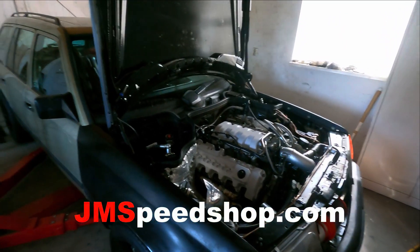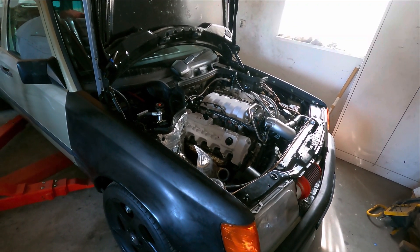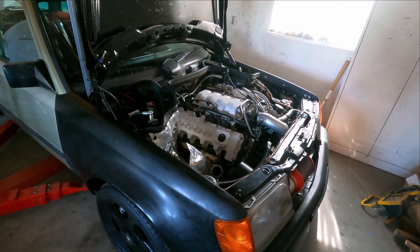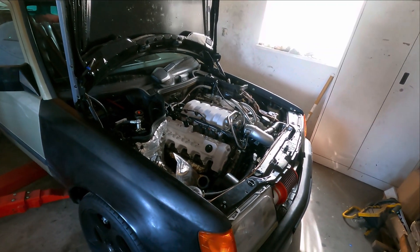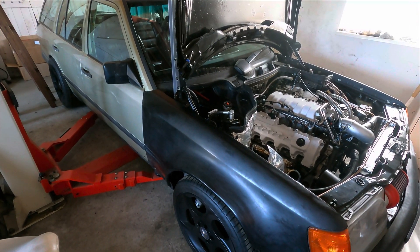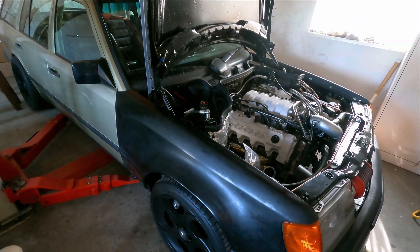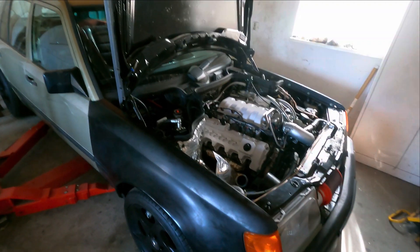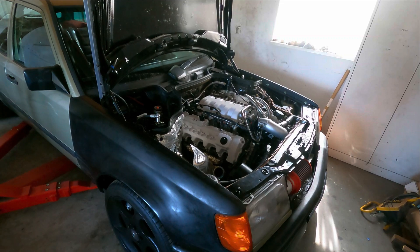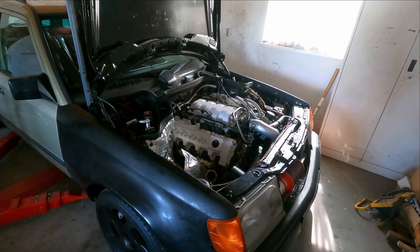For the people who didn't watch before, I've been on the dyno - that's two videos back. Got good results up to 4000 RPM. Made 389 horsepower at 4080 RPM and 680 newton meters at 2700-something RPM. This is correct for this engine because it's still ramping up. I suspect if I didn't have any issues after 4100 RPM, I still have over 440 horsepower at 7.7 bar on 95 octane fuel - pretty low octane, so it performed pretty good. I made about 120 to 140 horsepower more than an original 5-liter engine at 4000 RPM.